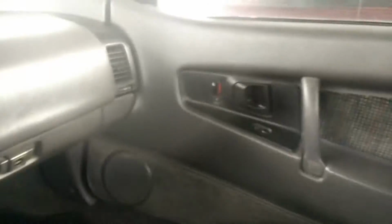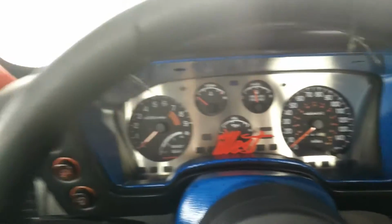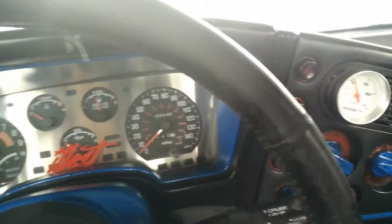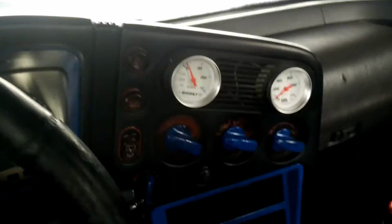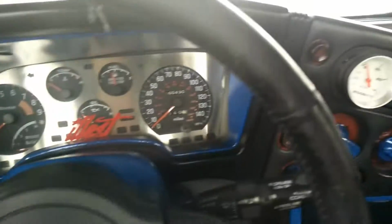So I was just going to show you guys the problems I've been having real quick, and then show you the interior. So just flip this around real quick. This is the interior. Really old, like I said, 1991, but everything is working, which is pretty cool. Motor starts, tranny works, everything works. The throwout bearing is just grinding at the moment, and the turbo oil return line is pretty much dumping oil because it's a 16G turbo and the 14B is a little bit smaller, so the oil drain line is longer. I can show you guys what I'm talking about when I get to the engine bay.